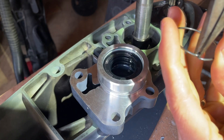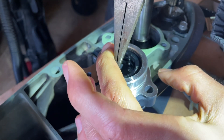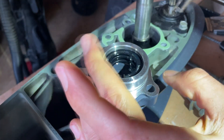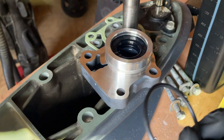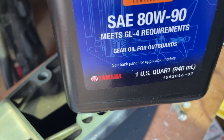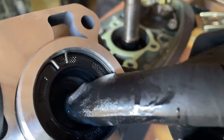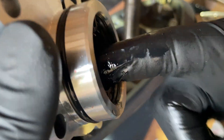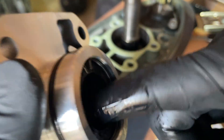The original water pump lower housing did not come with this retainer ring, but the new kit did, so make sure to install it before putting it back on the lower unit. Our water pump repair kit also came with an O-ring that goes around this lip right here, so we'll get that on and lube it up with some gear oil. Next, you want to lube up the inside of the oil seals before you slide it on so that it slides easily over the shaft without popping the springs off of the oil seal.